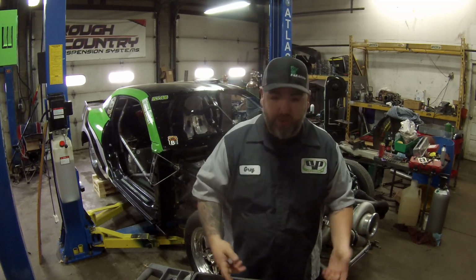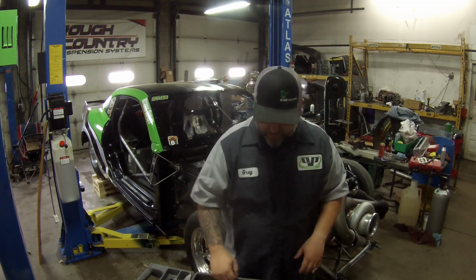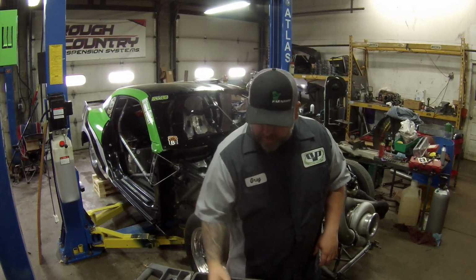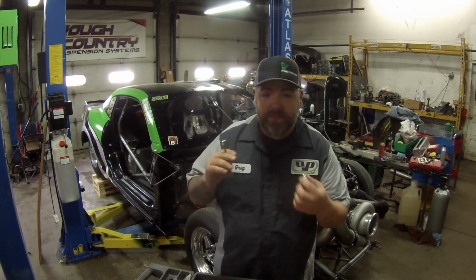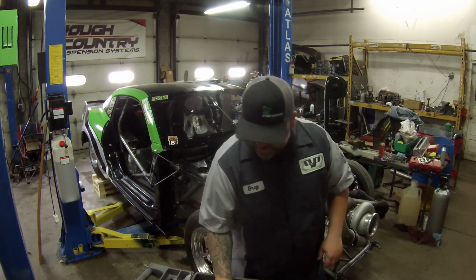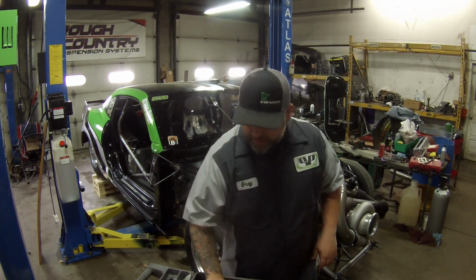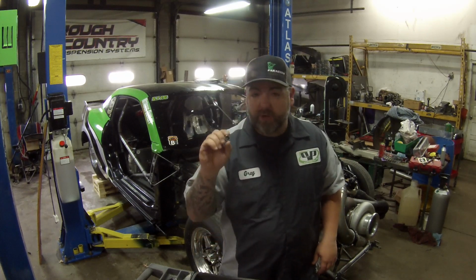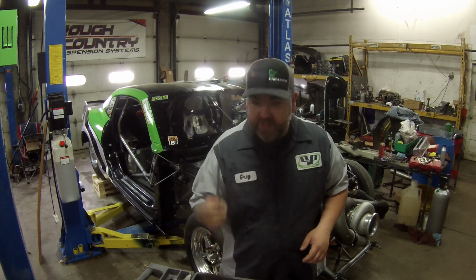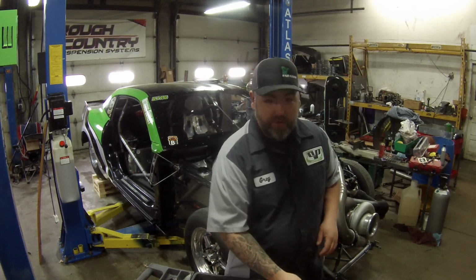Anyways, so to do this, I grabbed all my tools already. I'm gonna use a bunch of 1/4 inch stuff on here because then I torque it with the 1/2 inch. What do we have? 3/8 and 3/8. Oil pan is all 3/8 12 point on there. We've got a 1/2 inch 12 point wrench that I'm gonna use for underneath there, and a 1/2 inch 12 point socket for all of the rod bolts on there. We've got an extension to be able to get everything on there for the new ratchet.